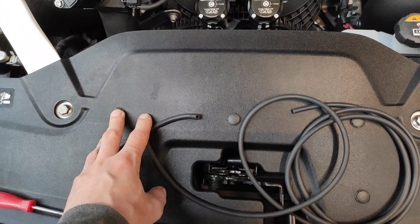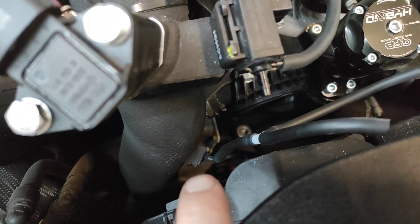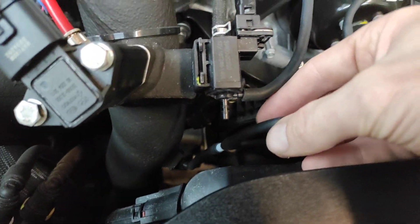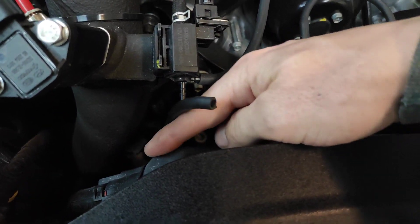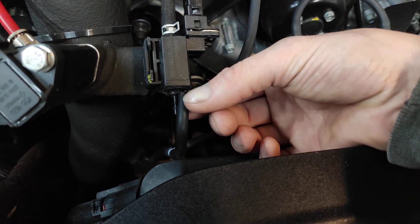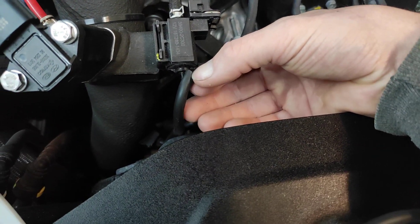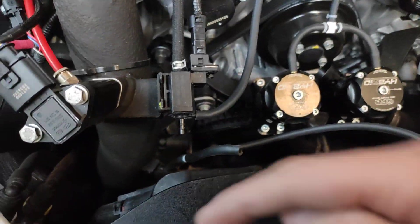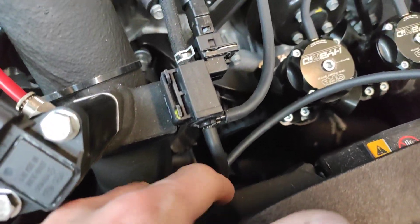There's currently a line here I just need to patch back together. As you're putting it on, try to slip it onto the nipple as far as you can. Since we added the T, the line is now longer. You don't want it super tight because of the 90-degree angle, and you don't want it hitting the fan shroud. Trim a little bit off at a time — start with about a quarter inch — until it's nice and short, stays away from components, but isn't kinked. Now you have plenty of clearance.